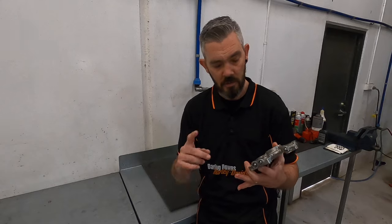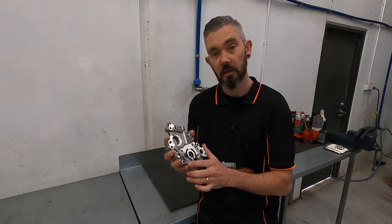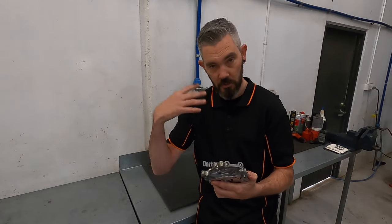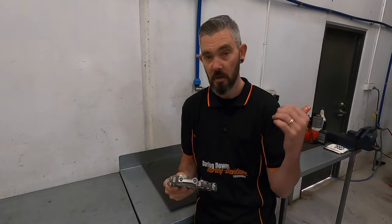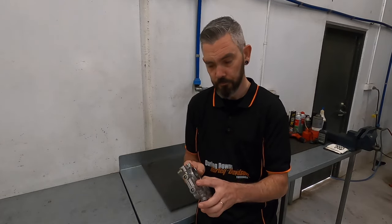The reason I recommend the Screaming Eagle option over the Fueling Pro Race series or the S&S one is because the Screaming Eagle is the only one I've seen that has not failed. I've seen the S&S ones fail — the brass bushing in there gets mucked up — and I've seen issues with the Fueling one too. That said, Fueling does have an option that is just a cam plate called the OE Plus, which works with the factory oil pump. It's a very cheap option, a little bit stronger, and has bungs you can pull out, flush, and clean — I've fitted them and they work just fine.